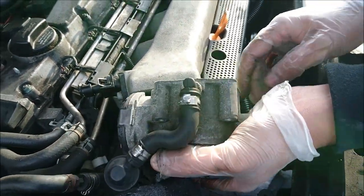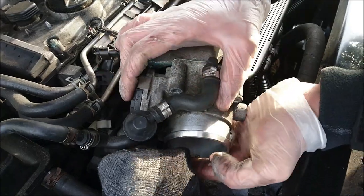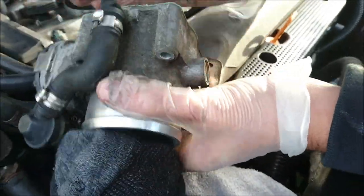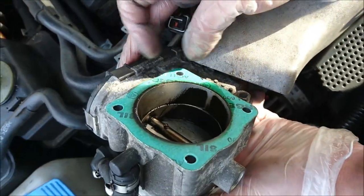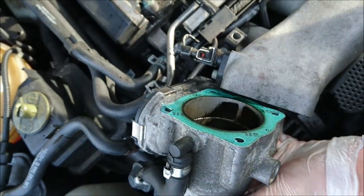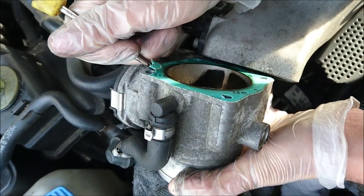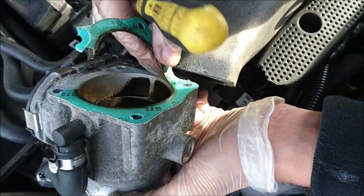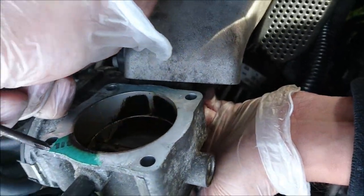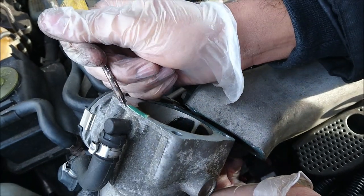Like we said, we're going to leave this connected — we're going to leave this breather hose connected as well. There's a socket at the bottom — that's the one you don't want to disconnect, if you want to avoid having to VAGCOM this thing. On the other side you can have a look at how gunky and dirty that is. This is the seal we're going to take off. There's no point trying to reuse it — look at it. It's made of card. It's been in this car for 177,000 miles.